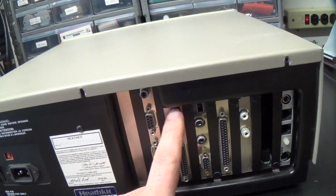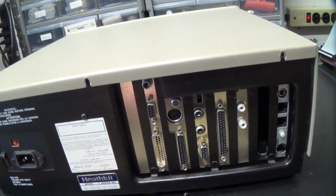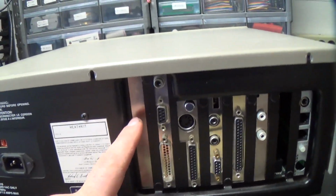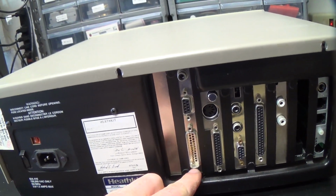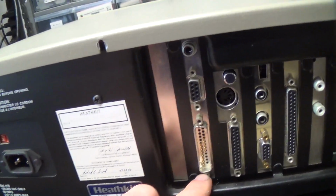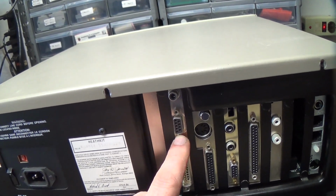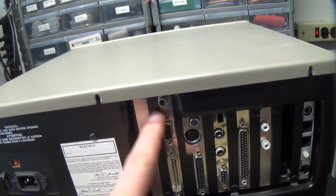So that must be, yeah, that's stuff that you'd usually find down here. Interesting, huh? I wonder what that means. And here is some kind of funny tall boy card that has what is almost certainly a serial port in it, given that it only has these particular pins crimped into the D-sub connector, and what we would have to assume is some kind of video port, as well as an RCA jack, which we would also have to assume is video, according to the manual.